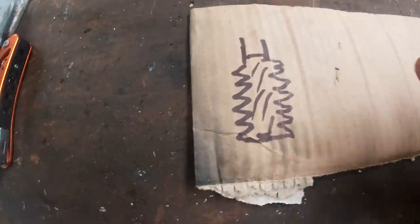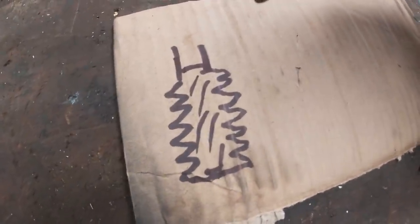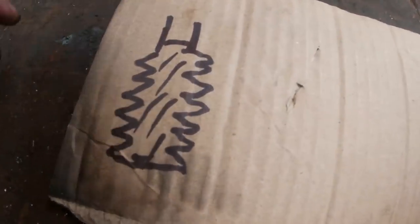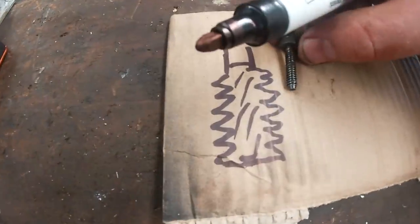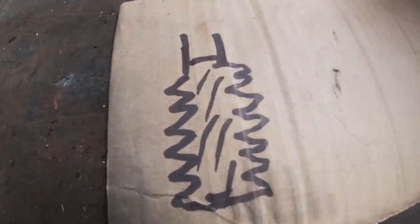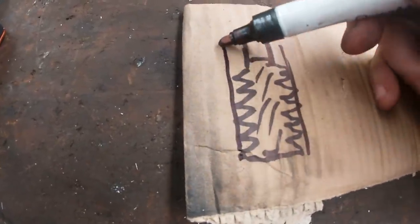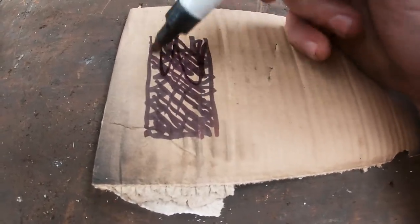Pretty compact. So just for anyone who wasn't quite aware of what I was doing just then, or what the problem was, this is just a bit of a rough drawing. Imagine this is a hole, and these jagged bits, that's the thread that the actual bolt itself screws into. So obviously you can see the shape of the thread there. Now this bit here, that's a snapped off thread that I had in there. So basically from kind of here down, that's what this bit is, and it snapped off, can't get it out. I've tried various methods to get it out unsuccessfully. So what I'm resorting to now, basically I'll just drill the whole thing. So I drill the hole larger, so it's kind of about this big, and then I filled it full of that putty, and that's fully filled up like that now, and that's going to set.